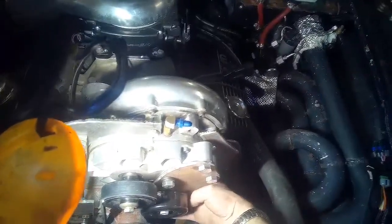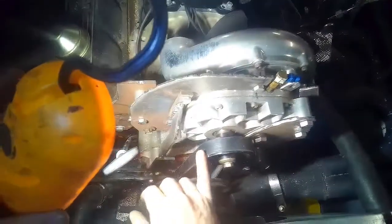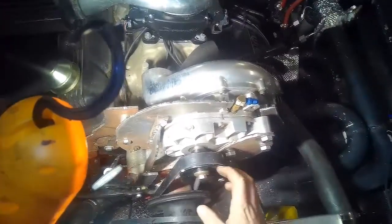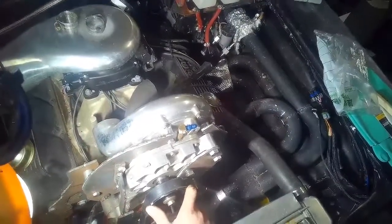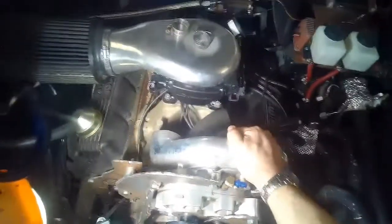You can see this little bright spot on the supercharger's pulley. I got a little carried away clearancing a couple things on the supercharger for this pulley itself, and got my grinder into the supercharger pulley for about half the width of it, so I'm going to have to order a new one. Still going to go with the 3 1/3 inch pulley, as that seems to give me about my 1.5 pressure ratio. So, you know, roughly 7 pounds of boost.